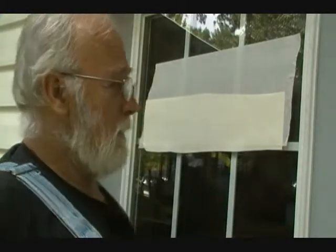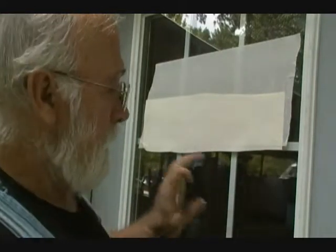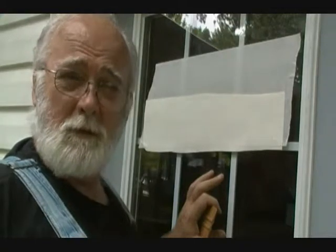I didn't bother to make up a quart of it. What I'm going to do is raise this up and rub it with a soapy dish rag, and then spritz some alcohol on it. I use the alcohol to clean glass, by the way. If you go to put a decal on your vehicle, don't just use Windex. It's got that ammonia in it, and your decals will not stick to it. It ain't worth a crap. You still have to go back in there with some soapy water and clean your glass to get the ammonia off.